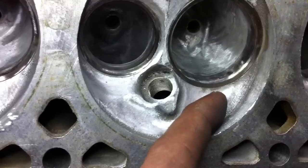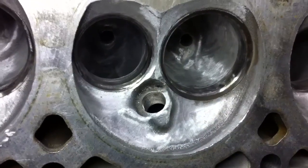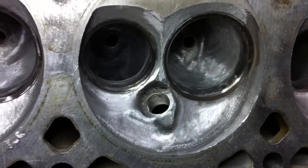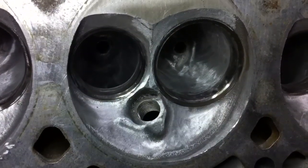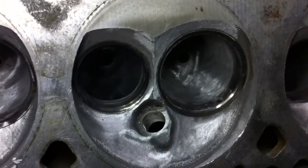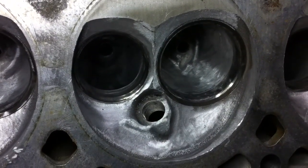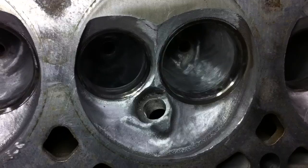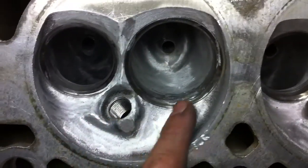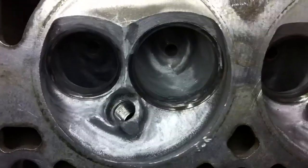When you start trying to dig down into the corners you end up eating away more meat off the side and the roof, which lowers compression. I'm trying to keep compression high on this engine — I'm going to mill it down 30 thousandths to reach 10 to 1 without having to change my pushrod length. Mill it down too much and you'll have to change your pushrod length. So I just went through and touched it up real lightly to remove some of that casting, and that'll be an improvement.